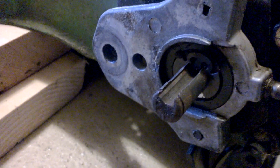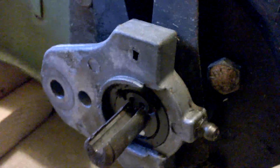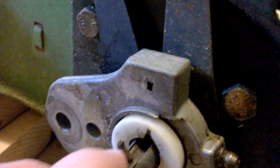It was very difficult to even tell where the key was on this side because it was so grimy that it really just looked like the keyway went about this far and then it stopped, and there wasn't a key in there, whereas this key, here's the actual key, was just covered up with grime, grease, grass, everything else. So here's how it's supposed to work. And bear with me while I get this back together. This key is supposed to slide free in here.